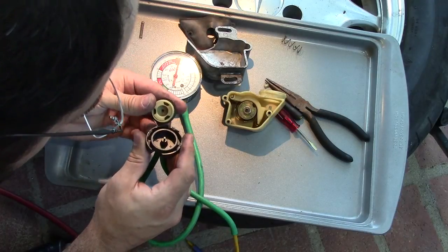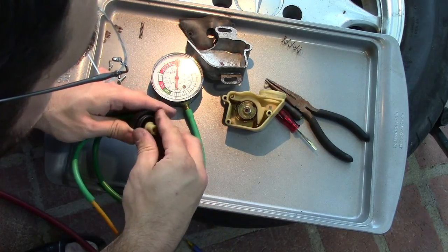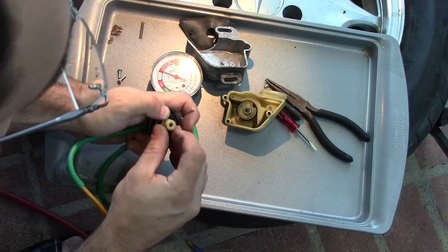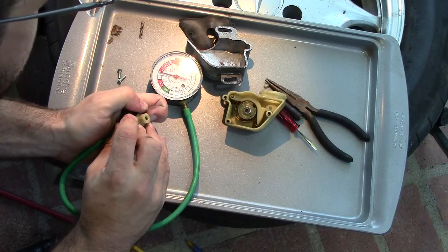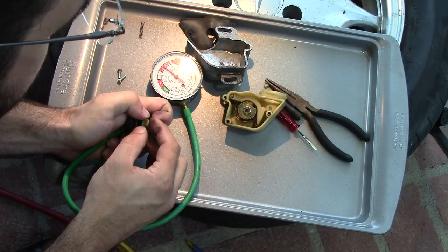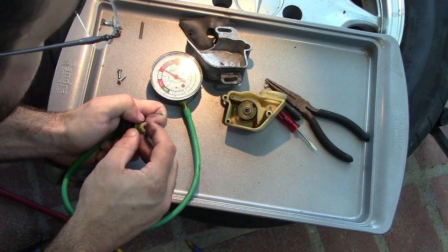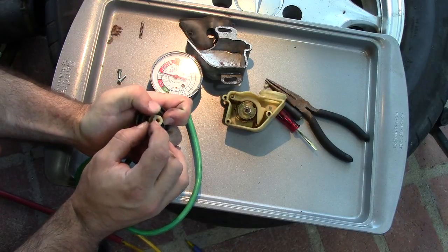If I set this on here, this is how it goes in the car. There's one other part — this spring sits in here pushing this whole piece away. This is a little tricky to do by hand, but if I leave it set like that and hold the seal on, you can see we've got about 10 inches of mercury, which is what the car does at idle. And then as you push the throttle linkage, that pushes on this and gives you less and less vacuum until you push it down. Then that little spring will totally cover the metal pipe on the inside of this and shut off all vacuum.